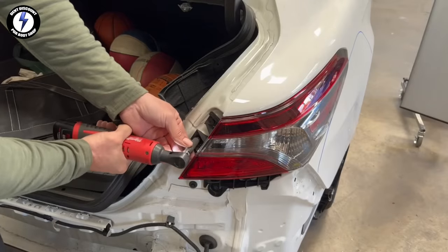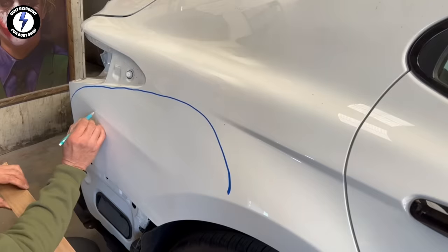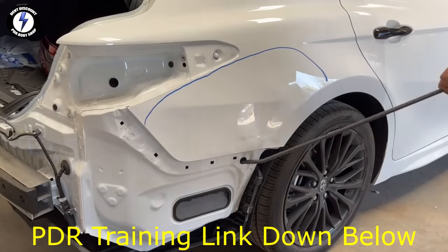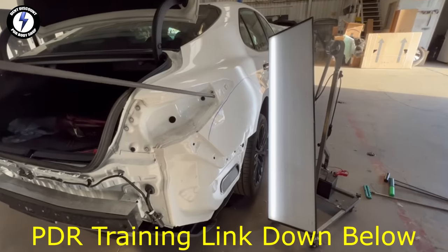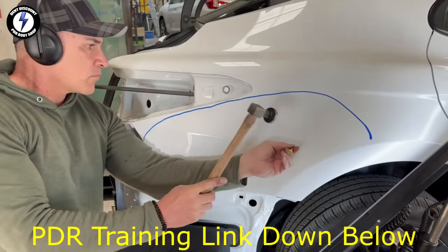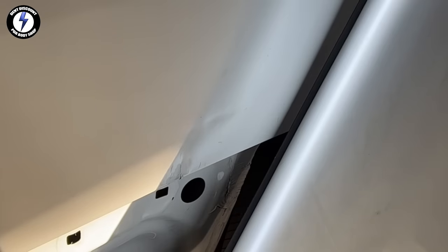I'm going to remove the brake light with a battery-powered ratchet. Using a pencil and straight edge to restore the body line. There are multiple access points for my paintless dent removal process. I slid my PDR bar through the hole in the brake light pocket, using multiple PDR tips to massage out the dent from the back side — starting on the upper section and working my way down. I went back to the hammer and knockdown to remove some more high areas, then made some final pushes on the crease and the deep section of the dent.